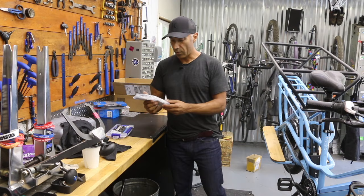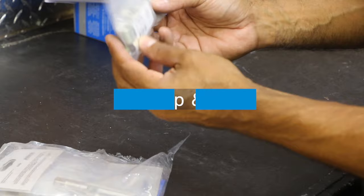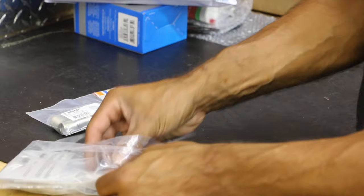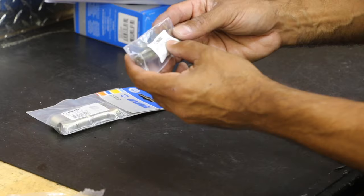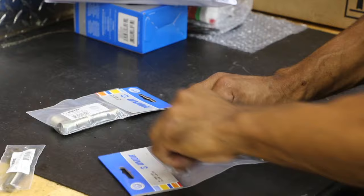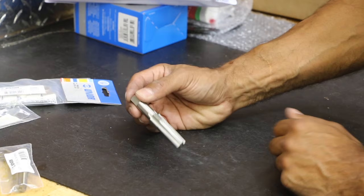We've got a reamer and some new helicoils. The company is called Unior. They gave me a bunch of bushings — these are 5/8 by 24 — and the full kit. It's got a left hand and a right hand version. We're going to be working with the right pedal, which is the drive side. This tool is going to clean up that crank arm hole and also create the threads at the same time. It's tapered with real sharp edges.